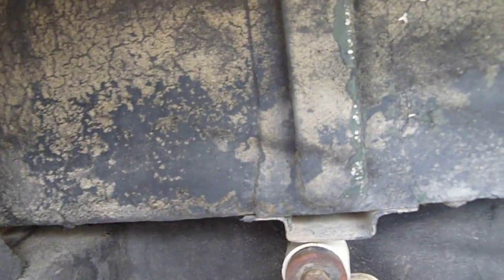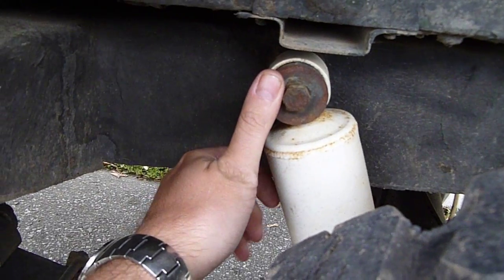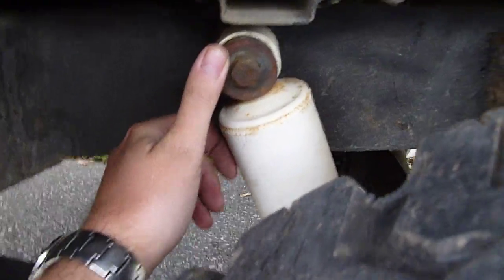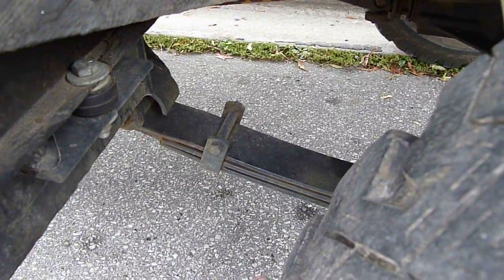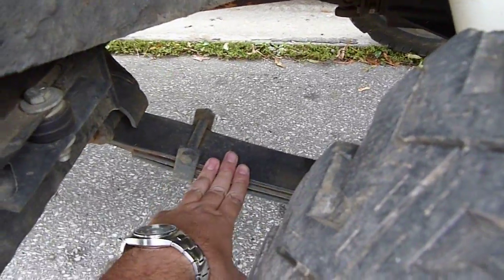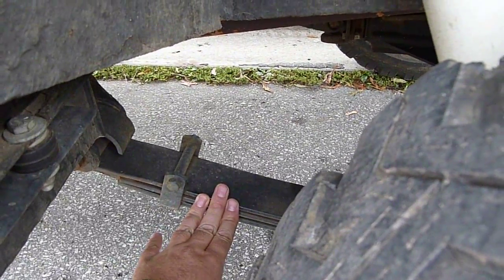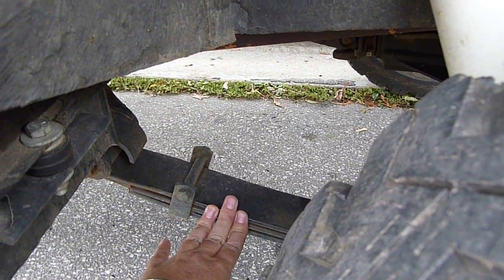I've installed 750 tires. Tires are not bad. All four frame rubber bushings have been replaced with new ones — cut the old ones out and put these in. New shocks as well. For those who off-road, it's got upgraded Rocky Mountain parabolic suspension. These are parabolics: three leaves on the rear and two leaves on the front. These are leaf springs, not coil springs like newer modern vehicles.